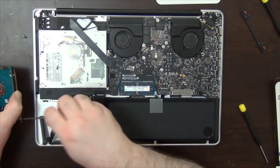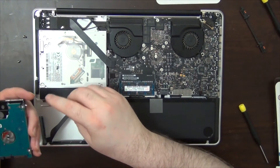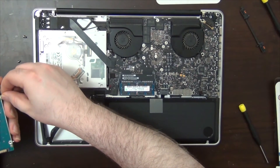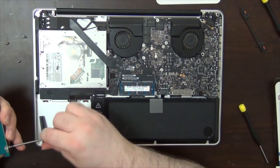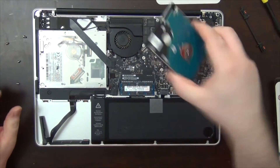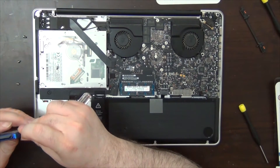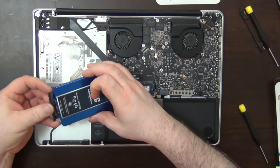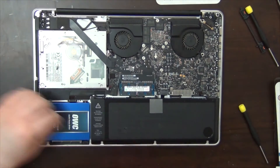When you do this, make sure your MacBook is turned off. Closing the lid doesn't actually turn it off — you have to do the proper power-down sequence so it's completely off, battery not running, no plug. Notice there's no plug in on this laptop. Now I've got the star hex screws transferred over to the SSD drive. I can plug the ribbon cable back in and place it into the eyelet holes — and the drive is seated.